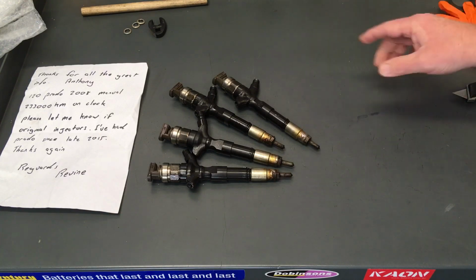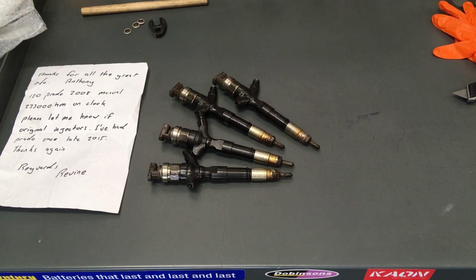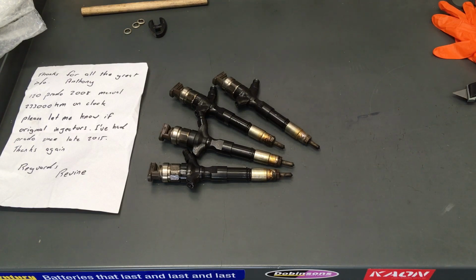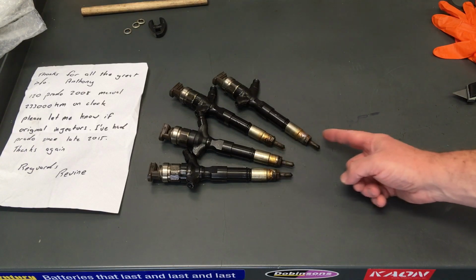These things, that's what I'm saying, 230. People go, oh, why 170? And you can muck around with your diagnostics and all this garbage, but you know what? The seats are about to leak. This is happening at 230. It can happen at 180, okay? It can happen at 130, 140, 150, but it's really low, probably 1 in 1,000. I don't know, I'm not going to do the mathematics on it, but safe to say, leave the damn things alone till about 170. Check your oil pickup, more so as you get closer to there. That's your free insurance. You guys already know this. But you can see they all started leaking, right?